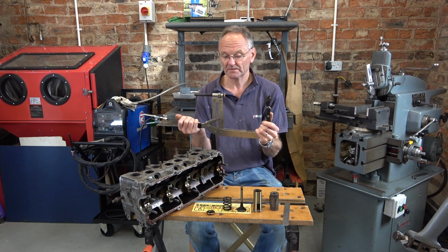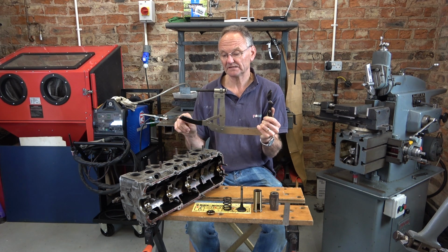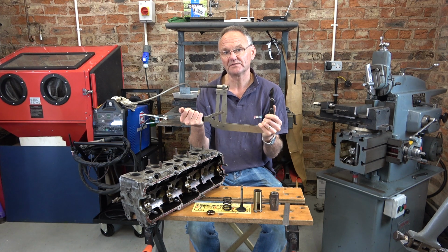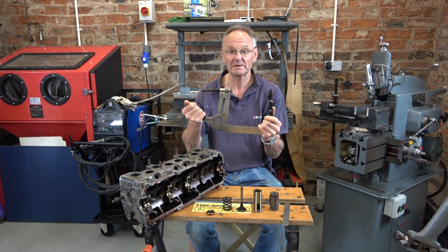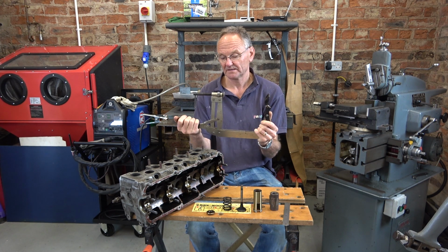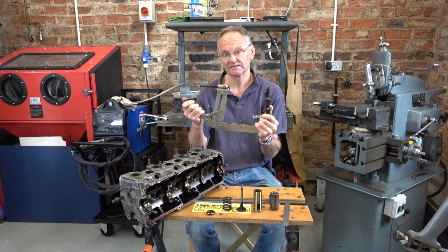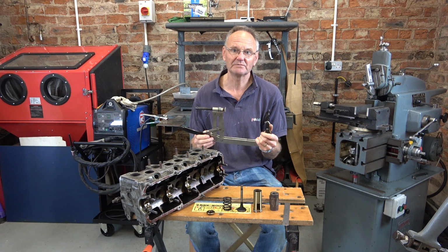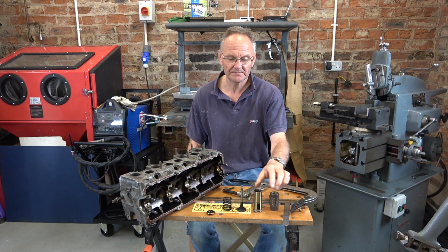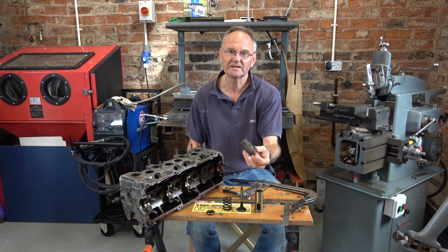The other thing is, when I tried to use this compressor, at rest the handle was down like this, and you get almost no mechanical advantage, and it's very difficult to close the compressor. So as I make a new sleeve to go in here, that handle at rest needs to be more like this. Okay, background stuff. Now I'm going to make a new sleeve to replace this one out of this piece of rough old steel.